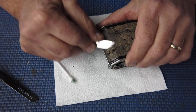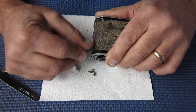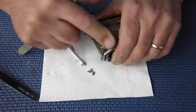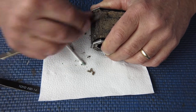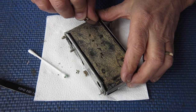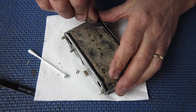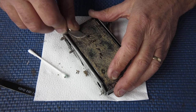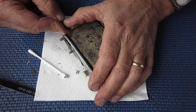Here I'm just shaving the remnants of that leather off that surface. I want that surface to be comparatively smooth, otherwise the leather won't sit back very smoothly. You've got to be very careful doing this - if you slip with your scalpel you'll certainly take that black paint off the body edges. The paint was never stuck very well to the back of any of these Retinas, and that's because the metal is aluminium. Aluminium is not a particularly easy metal to stick paint to. Best practice would be to use an etch primer, which basically bites into the surface of the metal and provides a tooth for your undercoats and primers to stick to.